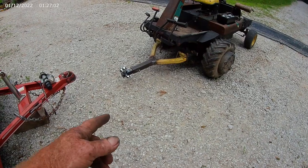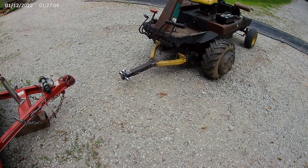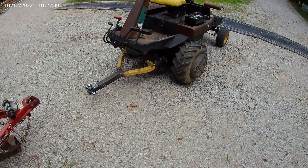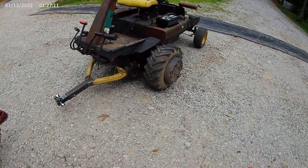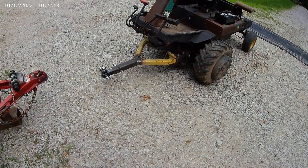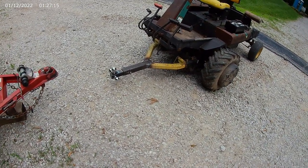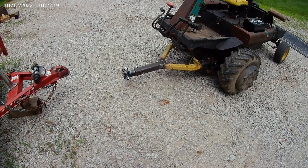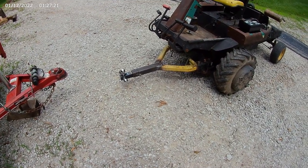The other thing I want to do is take this snow plow right here and modify it to fit in that receiver also — so I can move trailers with it, push some rock, push some snow, push some dirt, whatever I want to push with it. We put a three-way ball in the front of it, so you could put a receiver, a pintle hitch, anything you want in there. The two hydraulic cylinders that raised the mower deck will now raise that up and down, come out here, pick up your trailer, and carry it into the shop.